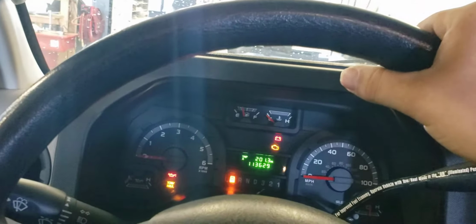Then you have your breaker box in here. All your breakers for your 120-volt appliances, and then all your fuses for your 12-volt. So you have all 15s and then 40-amp fuses for your 12-volt fuses. I recommend carrying some spare fuses with you, just in case. You never want to be caught without a fuse, so just carry some spares.